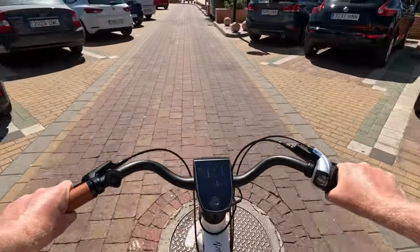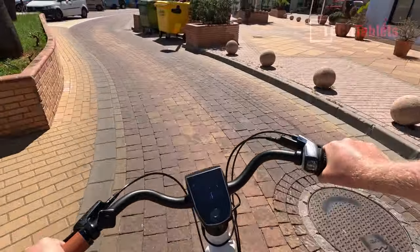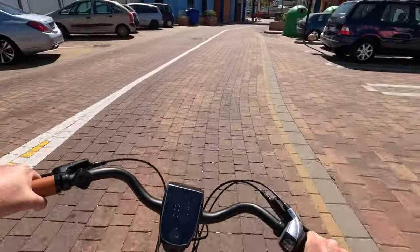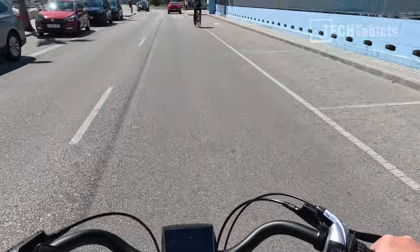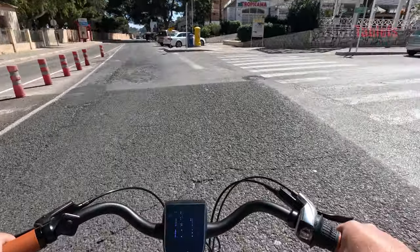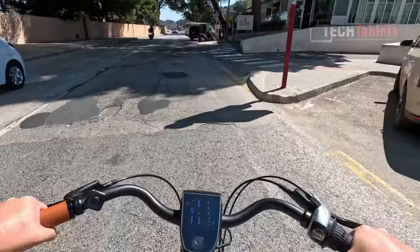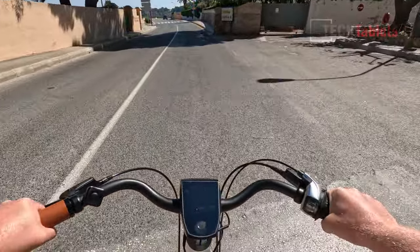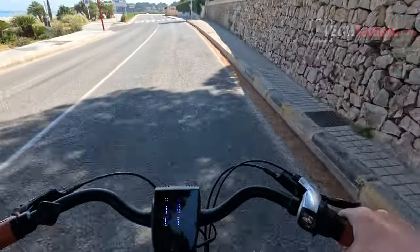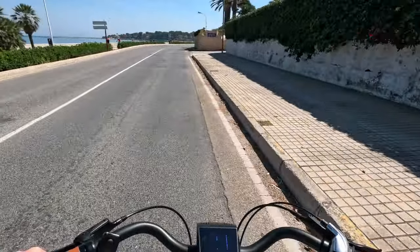The gear changes are really great. I like the Revo grip shift — it's easy to go up and down gears and the shifts are clean with no problems. The power delivery from the torque sensor is very smooth and practically instant, unlike speed sensors with no waiting. The motor assists up to 25 kilometers per hour, then cuts out — that's the EU legal limit for a 250W motor. With the high gearing, I can cruise along on pedal power alone up to around 30–31 kilometers per hour.